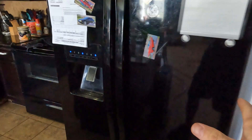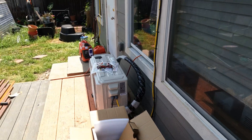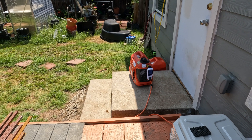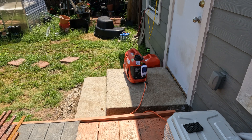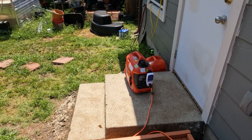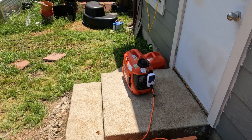The fridge is running, the compressor is running, and it's cooling just fine — pulling about 120 watts. What I noticed for a split second when the fridge kicked on is it went close to 1000 watts because of the compressor load, and the overload light flashed, but the generator did not go into overload. Induction motors have a ton of surge, so keep that in mind. I think it would definitely work in an emergency situation if you're just trying to power a fridge.